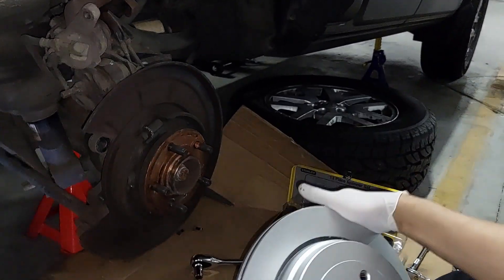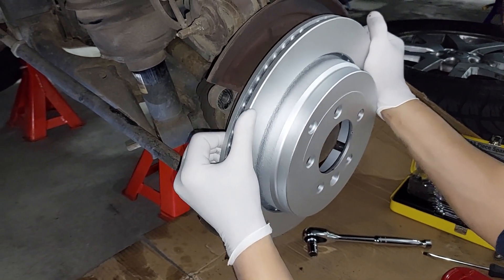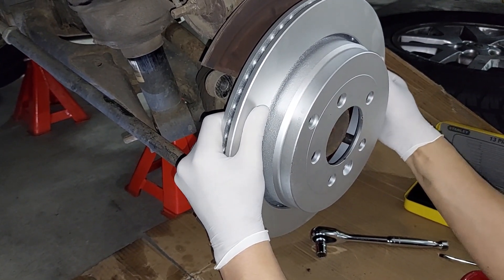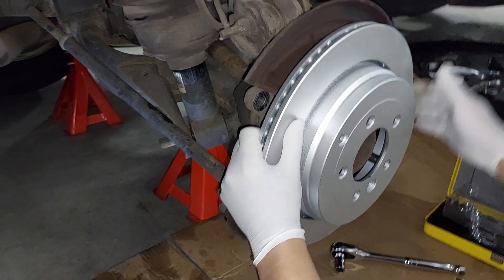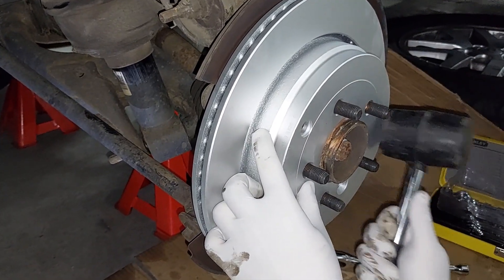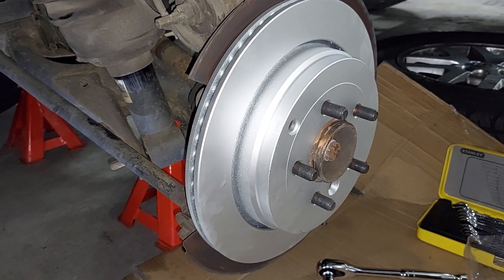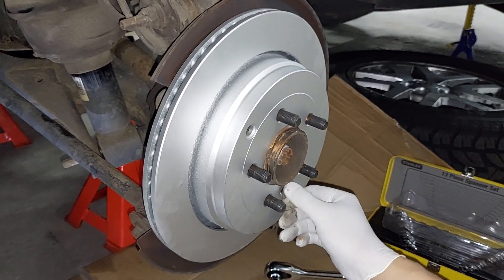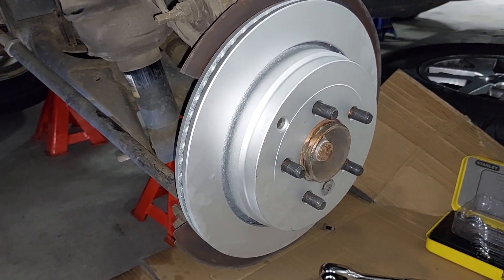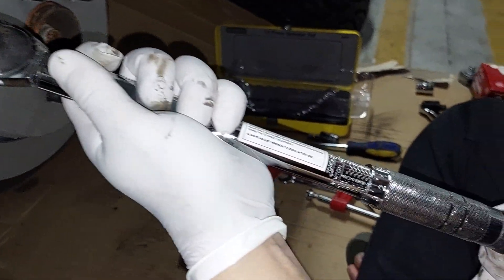The new rotor is here — I'm going to try and line up this hole with the hub and line up with the bolts and squeeze it in. I had to loosen that up a bit to get it in, then just tap it with the mallet. I'll put the holding screw in and torque it to 35 Newton metres.